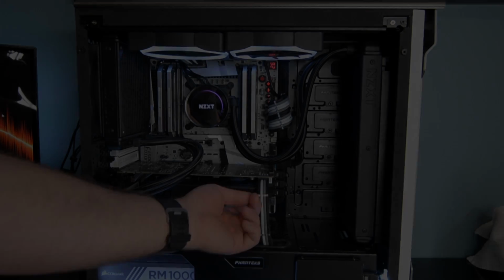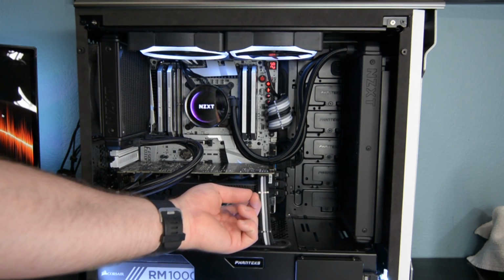Now, imagine you strip all of that away and you mount this bracket that's made to be compatible with a large array of cards, and it's kind of retained in place by one bracket, which is around the GPU itself, right? It's not bolted in multiple places on the card, so at that point you lose a lot of rigidity with your card, and you're still adding weight by adding the AIO cooler to the other side. And so I do see a little bit of increased GPU sag. It's not anything that I'm really worried about.